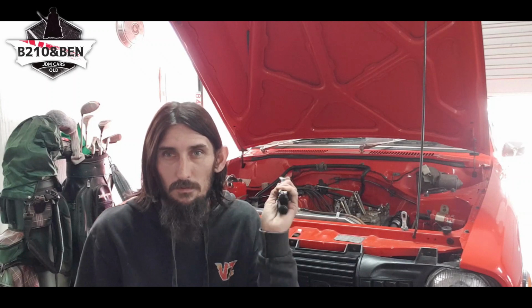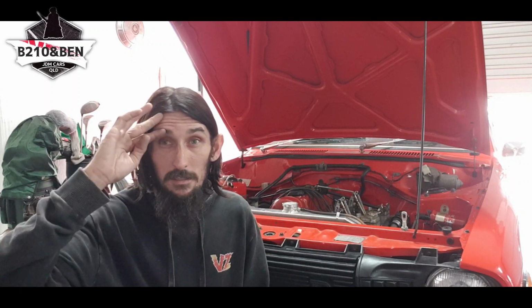So it's much more fun to drive now. It's got a lot more punch into the next gear. You can come down through the gears a lot harder, and it loves it. So all good. Today I'm going to adjust the timing. I'm pretty sure it's about 17 degrees, so we're going to go back probably closer to 12, as long as it still runs sweet, and leave it there, and then we'll see what happens from there.